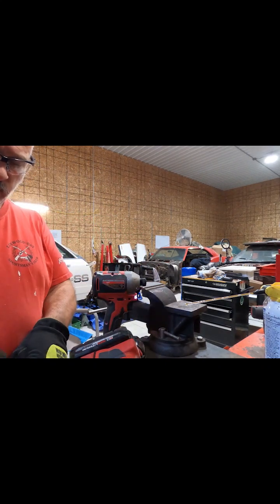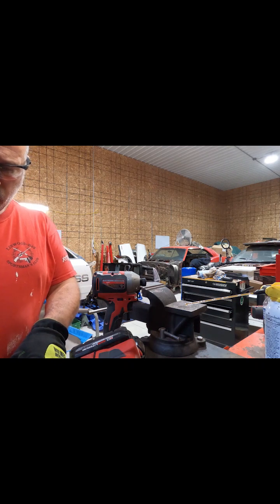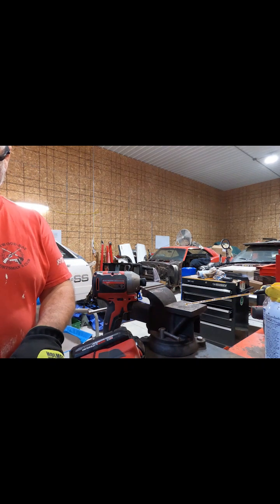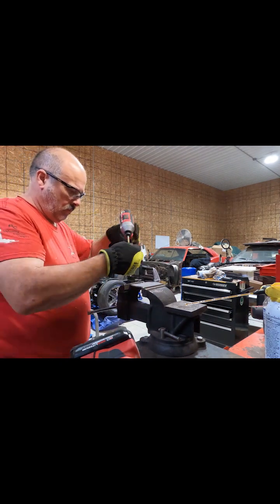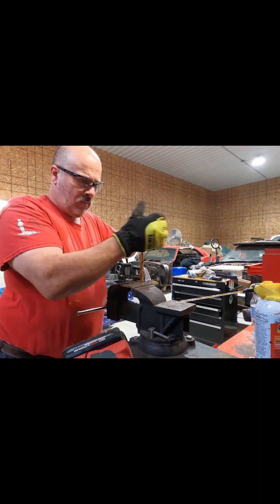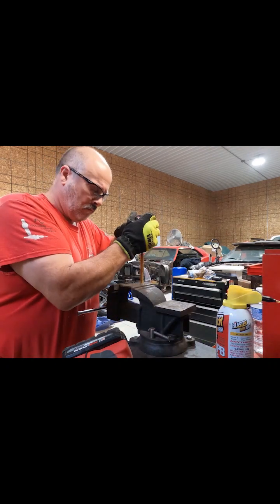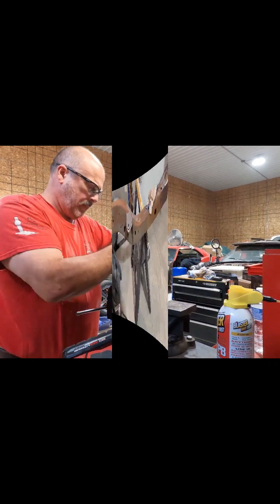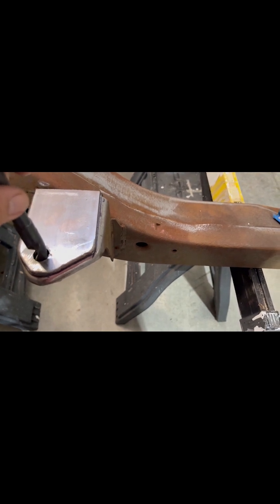So drilling the hole for the locator. Working my way up in sizes so it doesn't drift on me. Okay, as you can see, I got the first pad cut. I've got a 5/8 drill here, so I've used that as my pilot. So we're all good there.